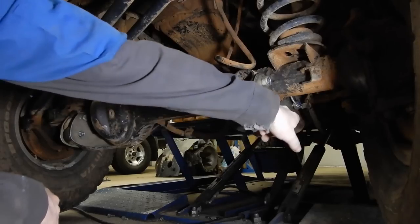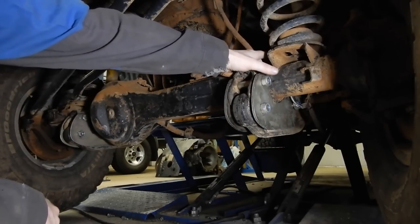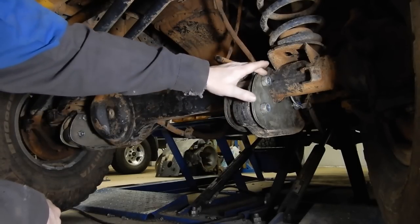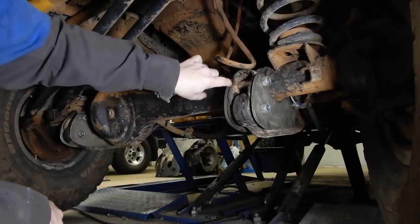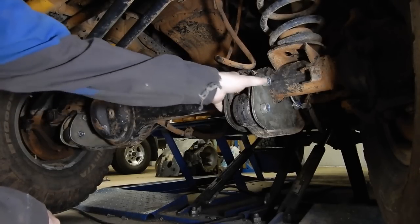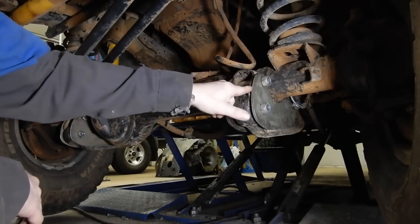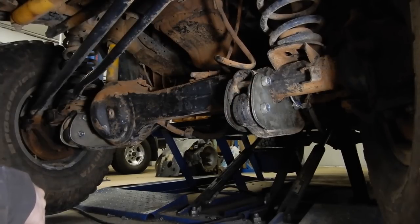It's 127 foot-pounds on these front three and 130 foot-pounds on the frame side. I've just got the nuts on here loosely — I need to take these back off and put some red Loctite in, then torque everything down. I also like to clean up this leading edge here and run a bead of weld just to tie everything back together. I'll torque everything, clean this up, and then bring you back for the weld bead, and then we'll do the final assembly.